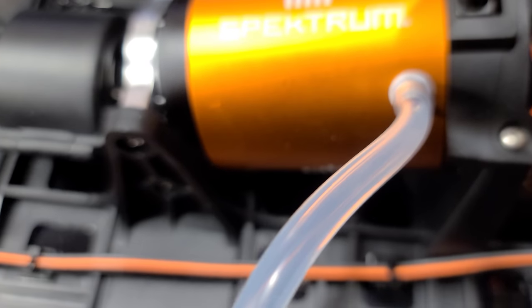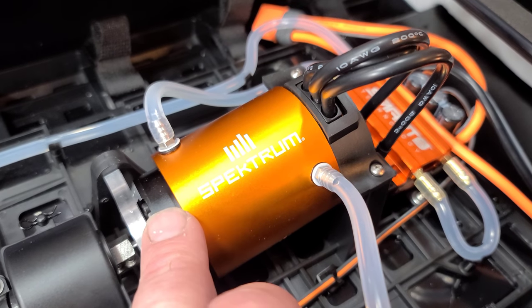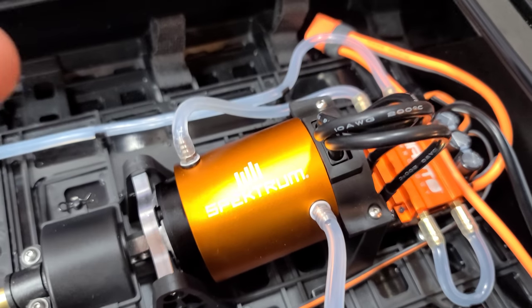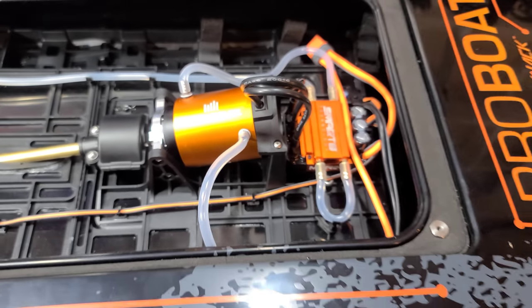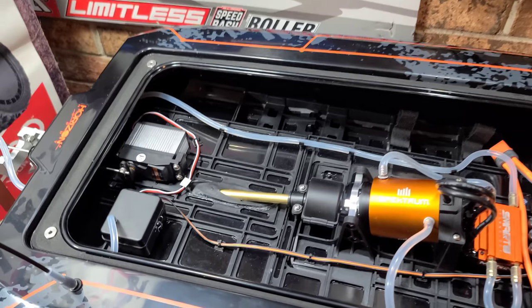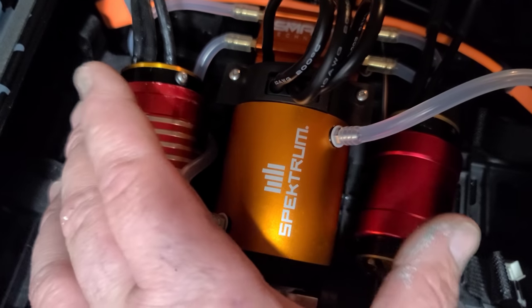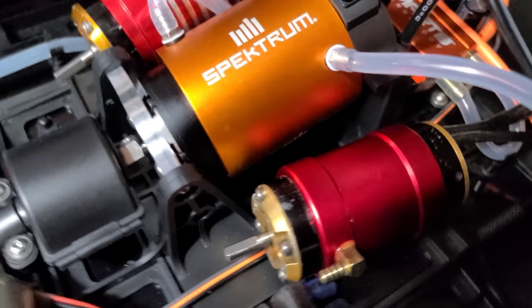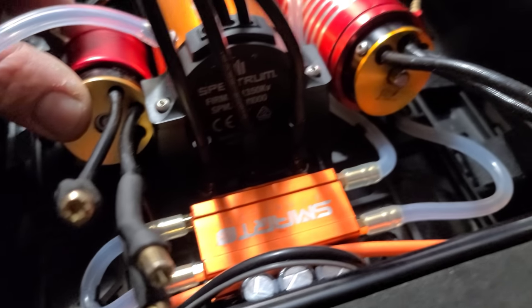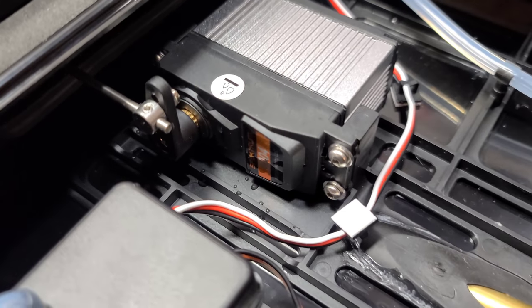Let's go inside and take a look — give you a little tour of the interior of this hull. You've got a 4685 brushless motor, 1350 kV, water-cooled — a massive brushless motor for a massive boat. Everything about this boat is beefed up and supersized. Just look at the sheer size difference of this Spektrum 4685 compared to a 36 and 40 millimeter motor. It's a fifth-scale giant servo.